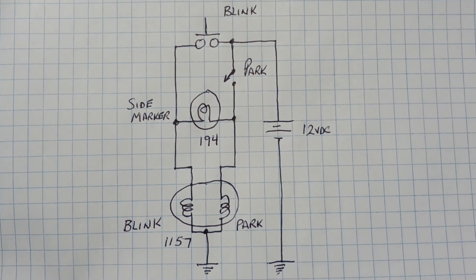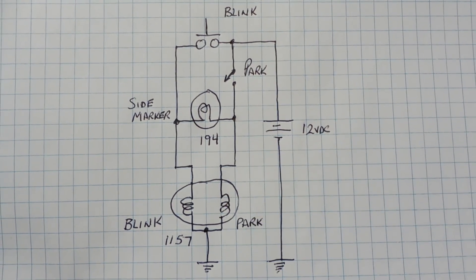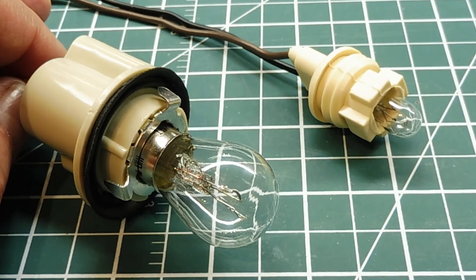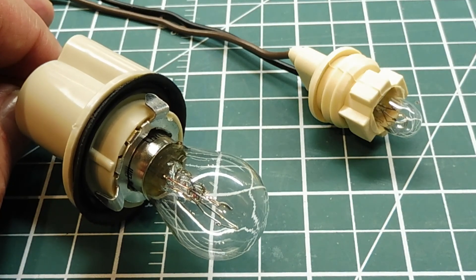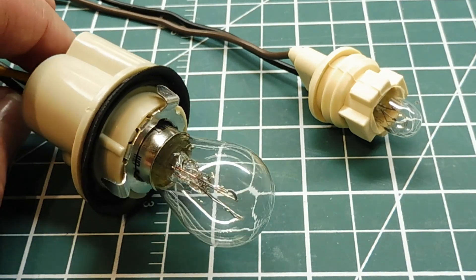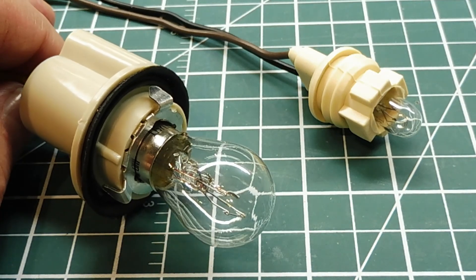So that's how the circuit works — pretty simple. That's what the engineers came up with, using the two different resistances of the filaments in the two bulbs to build the 70s blinking circuit. Now you know how it works — if you have an old 70s GM car, go check it out. Remember: the simple solution is usually the best solution. Think in simple terms, don't follow the crowd, think outside the box. Next time you're designing a circuit, just think of this 1970 GM blinking circuit.